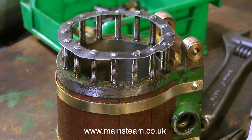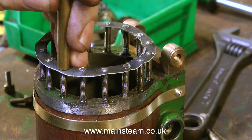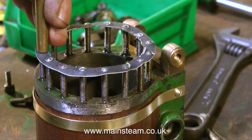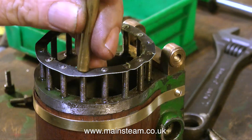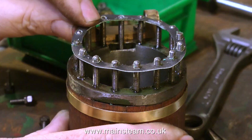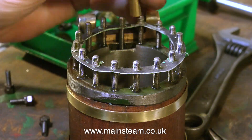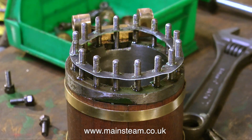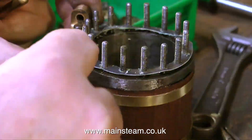The next thing to look at is the gasket that I made. On this design of engine the cylinder walls are quite thin and there is not much meat for the gasket to seat against the cast iron, so I have to be careful. Also the holes are quite a tight fit on the studs — this is intentional, I prefer it this way, as it stops the pressure from leaking up the stud and bubbling around the nuts. I make a simple tool to do this: just a piece of brass drilled which clears the thread, and you press it down very carefully a bit at a time.